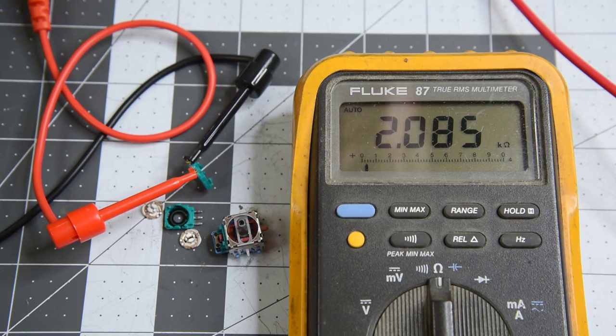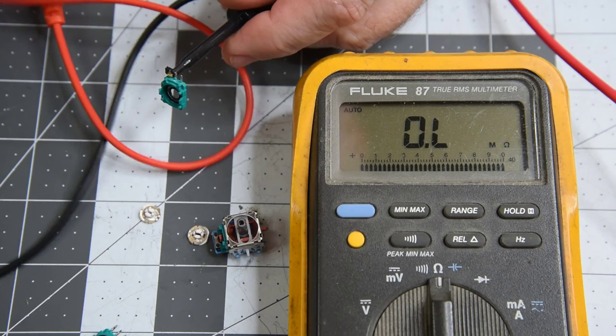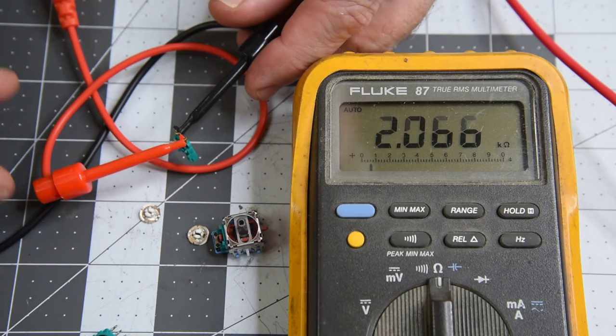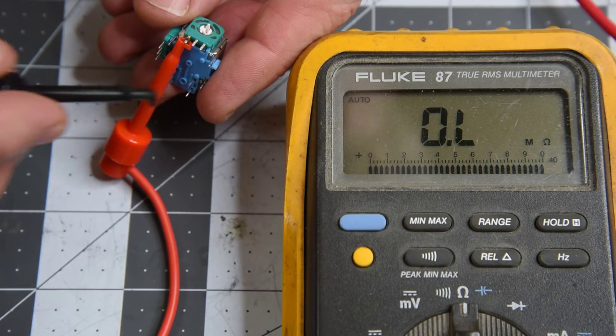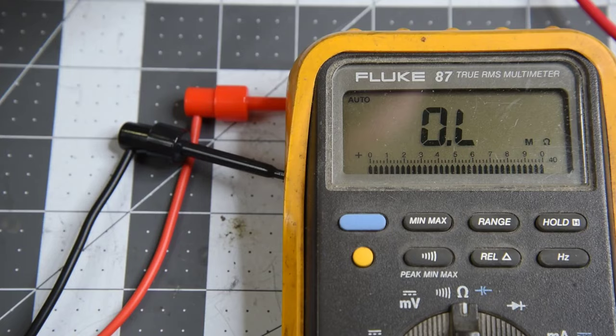This is where the PS5 and PS4 joysticks differ. These Alps-made potentiometers look like they have a value of about 2.1k — no value printed on them so I can't say for sure. The Favor Union ones I'm going to replace it with have a 2.3k value, and it's printed on the potentiometer. Potentiometers that go into PS4 joysticks are 10k — at least all the ones I have seen. While mechanically the same, the potentiometer values are different, and I expect Sony had a reason to lower the value — a reason other than to make life difficult.